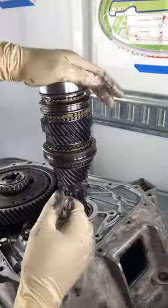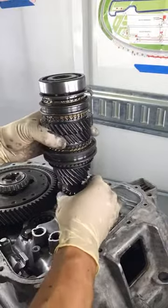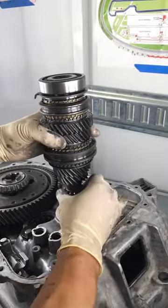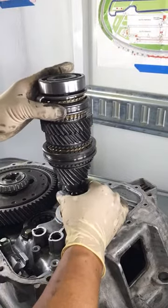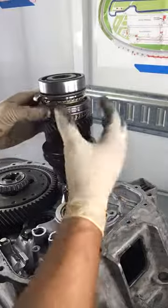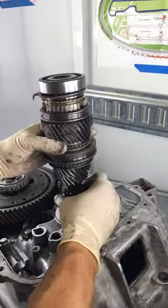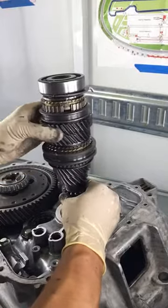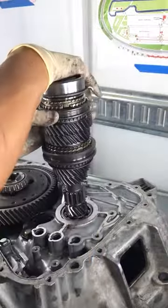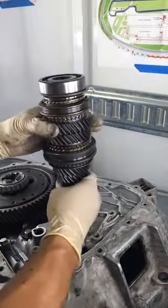If the motor is turning, this shaft will be turning, but notice I can grab the gears and hold them still because they're not attached. The gears will not be attached until the sleeve is actually engaged over the gear like that. Now fifth gear is locked. But I can still rotate, and fourth gear is not attached at all — but fifth gear is. But once I release the sleeve, fifth gear can rotate on its own.